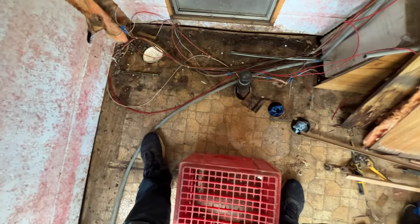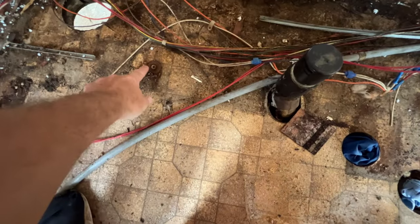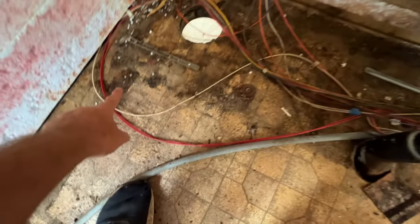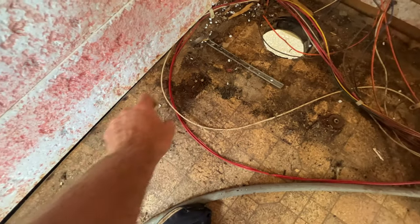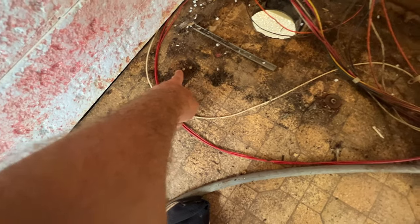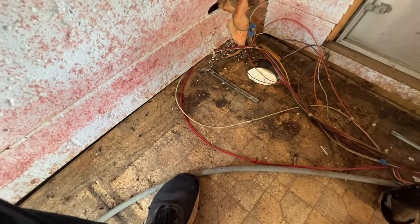So holding down the fiberglass body, the shell, the frame, what they've used is they've got these screws going through here. Well, they're bolts, but they're self-tapping bolts. There and there, those going right through into the frame rail. And then there's this bolt back here. This goes through to a piece of angle iron that runs along the back. And this is really what bolts it down, these ones here. So these are the main bolts that hold it down. And they were rusted right solid. I just ground them right off and we'll replace those with some nice new bolts.